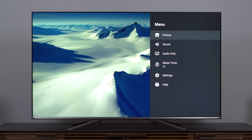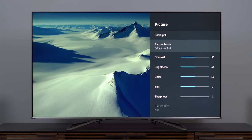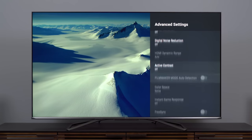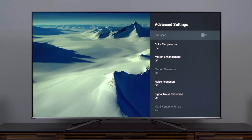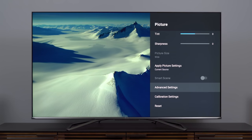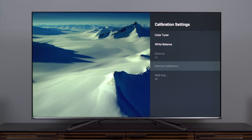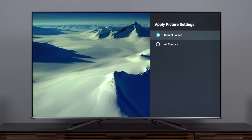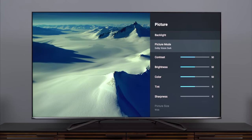Pausing on a Dolby Vision title on Netflix, going into picture settings, and we're in Dolby Vision IQ mode. I'll save a full discussion of what Dolby Vision IQ is for the full review. For now I'm going to Dolby Vision dark and will go back and forth between dark and IQ. In advanced settings, color temperature is low and because it's Dolby Vision, all motion enhancement and smoothing has been turned off automatically — fantastic. Filmmaker mode auto detection is also off; that's something Dolby likely specified as a requirement. That's one of the great things about Dolby — they have control, and you know what you're getting. Gamma and gamma calibration are also locked down, because Dolby has control — it's an end-to-end solution. Note that the picture settings here apply only to the current source, so anytime I go into Dolby Vision, I expect to be in Dolby Vision dark.